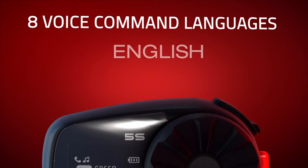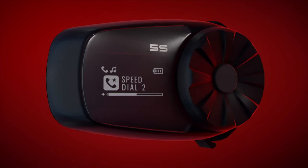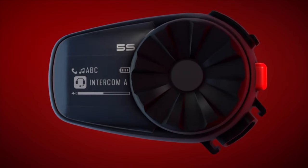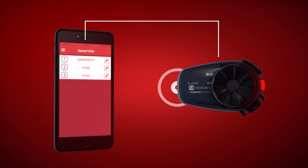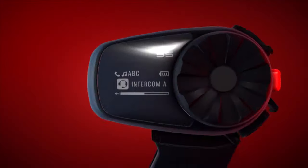It comes fitted with the new HD speakers, which do sound really good, and because you can connect this up to the Sena utility app you've got an equalizer so you can change the sound profile. You can set up voice commands on this, and it's also got an FM radio. The thing that stands out for me is the little digital display on the outside — while it's no use when you're wearing the helmet, when you're trying to pair with other riders or change configuration settings without the helmet on and can't hear the audio prompts, that display is a really good addition that makes it much easier to set things up.